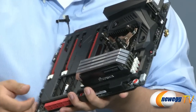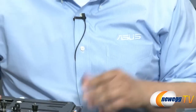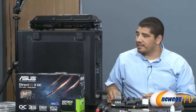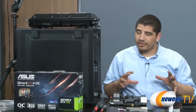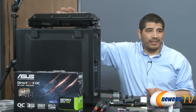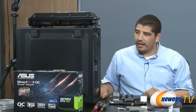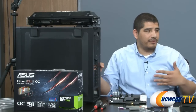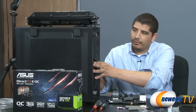So I just wanted to use water cooling to make sure everything was as cool as possible and also offer me a really cool and quiet experience. Not to say that an air-cooled solution is always going to be louder than water cooling, because with water cooling you still have fans in the radiator that need to be customized, but generally you can maintain a very high performance system and have it be fairly quiet when you go with a water cooling route.